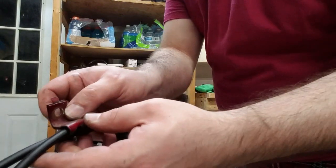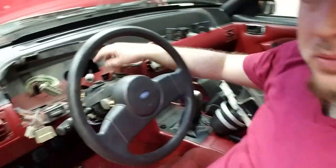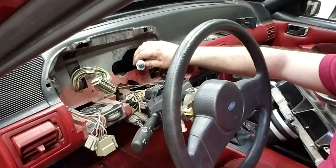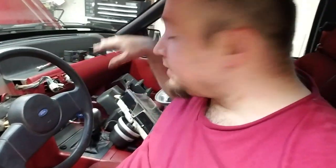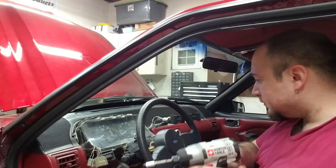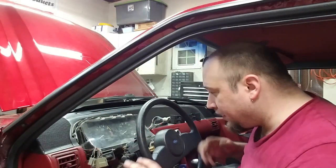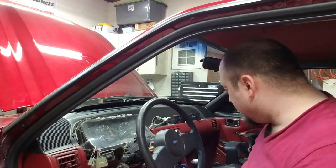I got the frame rail bracket back on as well. Now let's snake this back in, reattach everything at the bottom, lower the car back down, and then jump back into the interior. It's getting late but we're still pushing through. I was fighting the grommet on the firewall putting it back into its spot — it is a tight fit and not a lot of space to work with. I tore my hands a little bit, but hey, it's part of the game. We got the new cable in. Everything's put through. We're going to reinstall the gauge cluster and button everything back up. Cluster's back in, everything's plugged in. Now I can go ahead and reattach the surround and get it all completely finished up.